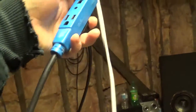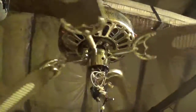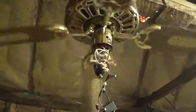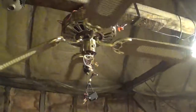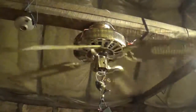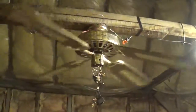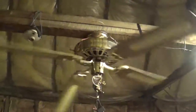I also need to explain what got wrecked on the fan. Obviously it wrecked the reverse switch - it kind of cracked and very slightly melted it, and there's a slight wire kink in the way, so that switch will need replacing. It still functions fine though. The motor also gets very hot after maybe half an hour to an hour on high, so I'm guessing it's got some shorted windings - and it still hums.